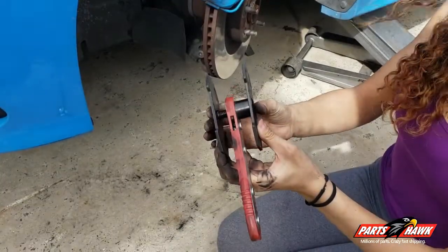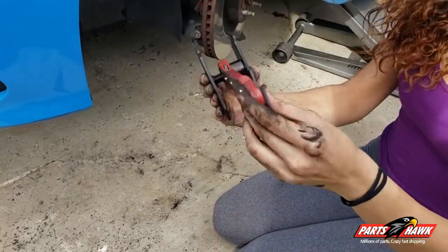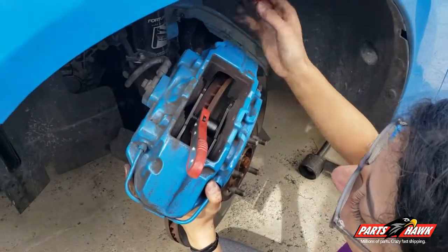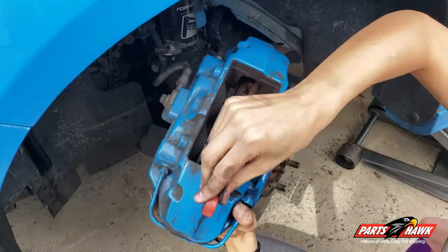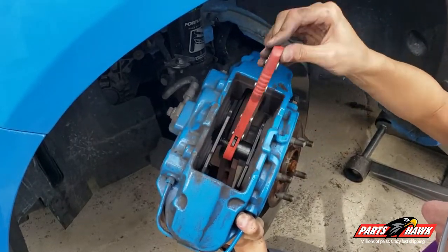So now that we have the caliper removed, we're going to take our piston compressor tool that's going to be linked in the description below. You're simply going to place this inside the caliper and torque it out, and it's going to push the pistons back into the caliper so that way we can put those new brake pads in.